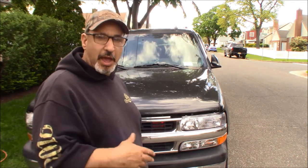Now, I thought this was a good video because replacing an alternator is a very simple do-it-yourself thing. Diagnosing an alternator is usually pretty straightforward for the do-it-yourselfer. Your battery's going dead on you, and you start the car up and disconnect the battery, and then the car dies immediately. It means the alternator is not putting out enough juice to sustain the engine running without drawing from the battery. How do you double check yourself? With a meter on the alternator while the car's running, see what kind of output the alternator is putting out. Mine was putting out in the low 8s. Right, should be in the 14s at idle.